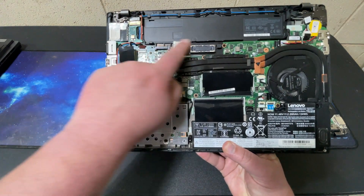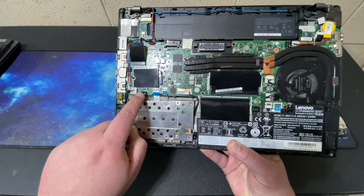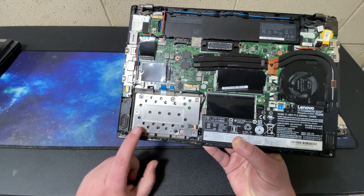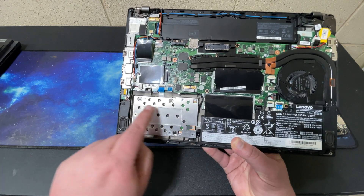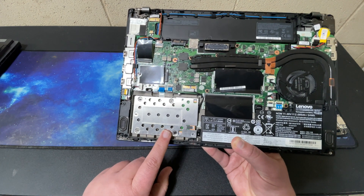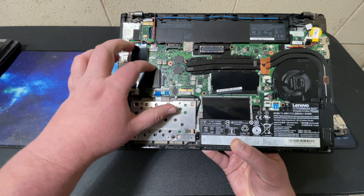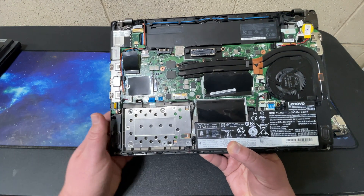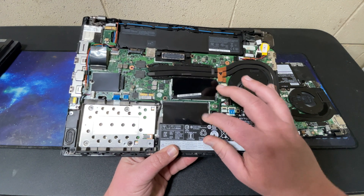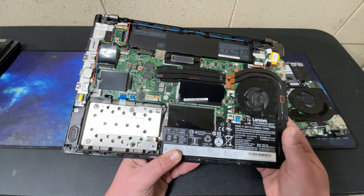So we have the internal battery; this is where the easily replaceable battery goes. You have a drain hole here for the keyboard and one here, so this has two drain holes. It has the cutout for a two-and-a-half-inch drive, but it is an NVMe drive — so if you unscrew this and flip it to the other side, it's just an M.2 slot. This is for your WAN, which I don't have on this model. It has two RAM slots; I'm running 16GB DIMMs, so 32GB of RAM.